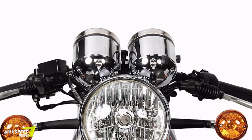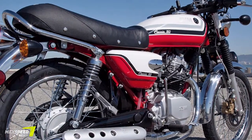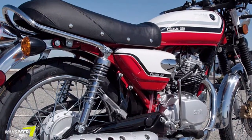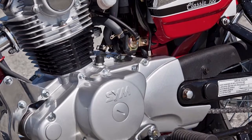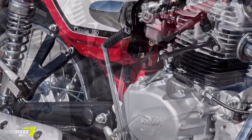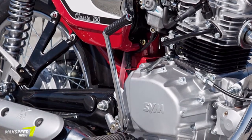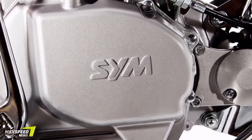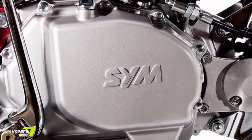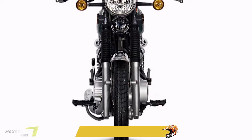A 149.4cc four-cycle thumper serves as the beating heart for the Wolf Classic. Air cooling precludes the need for a radiator and keeps the engine as simple and light as possible while preserving the cleanliness of the look. An overhead cam actuates the valves, eliminating the mechanical losses associated with pushrod valve trains, and the little mill runs with a 9.6:1 compression ratio, so yeah, the Wolf has an appetite for 90-octane fuel or better.